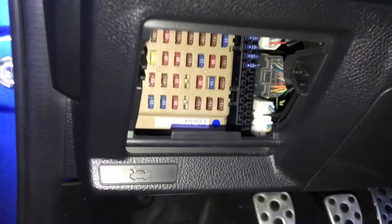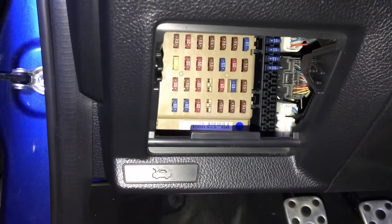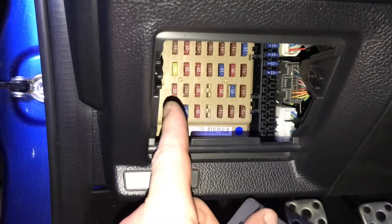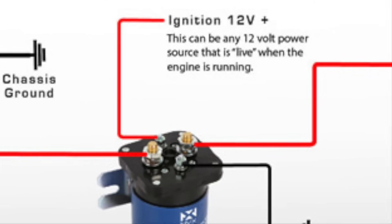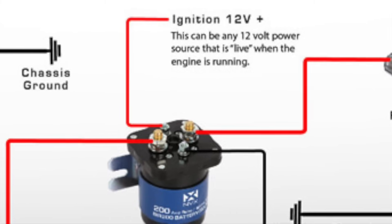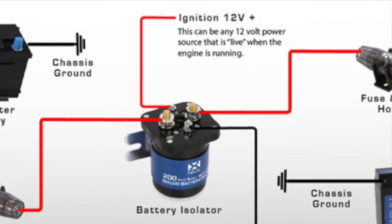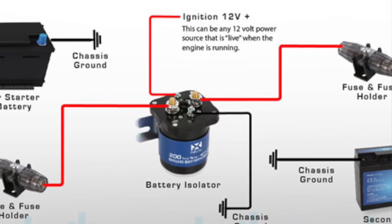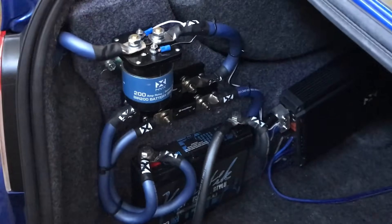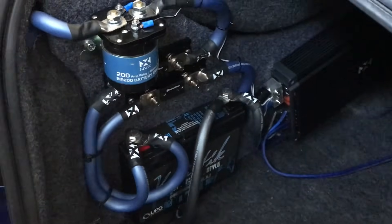By the steering column we have our fuse box, for example in this WRX. The wire you need to tap into for your positive trigger wire on your isolator may be located as a source on your fuse box. Most of the time you'll have some sort of diagram to identify what fuse goes where — what we're looking for is a running source, only on when the car is running and started, often labeled under ignition. Using a multimeter, begin to find out which source is only on when the key is on and the car is running. Every installation is different — some may argue that with the same battery type under the hood and in the back, an isolator isn't needed, and that may be the case. That's totally up to you and your install.